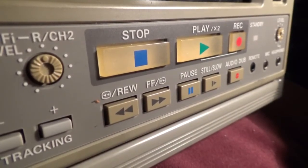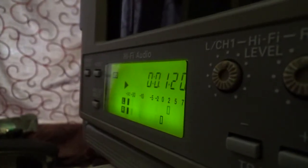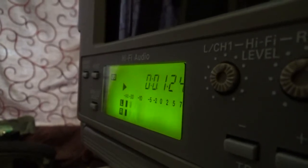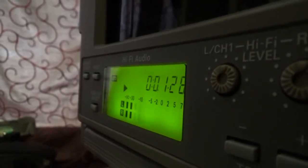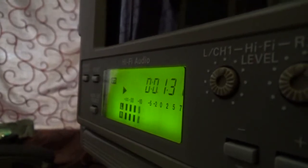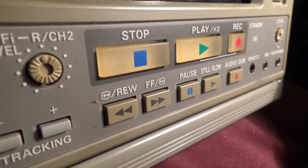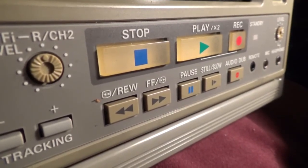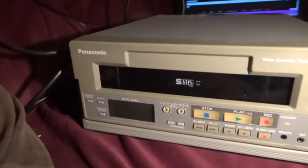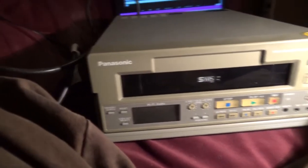It's unfortunate, but this is a thing with older machines where you have to find this fine balance. We could compress the video more, but we just don't have the power, so there's no codec on the card to do that. Yeah, the compression we're using is done on the card, and it is then decompressed and decoded by the capture card as well. It actually displays the video playback in the same way it does an incoming video signal by overlaying it onto the VGA signal that it's receiving from the graphics card.